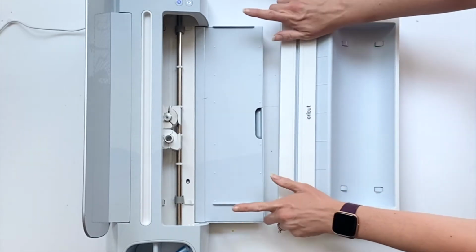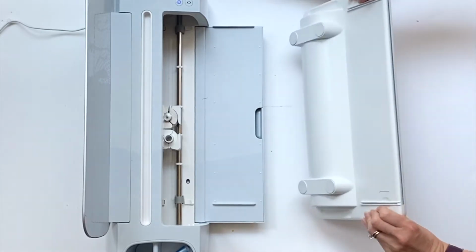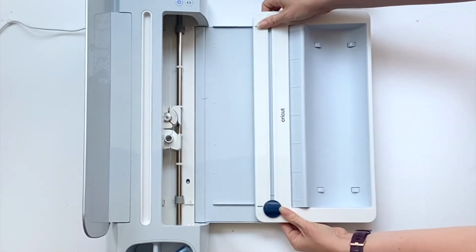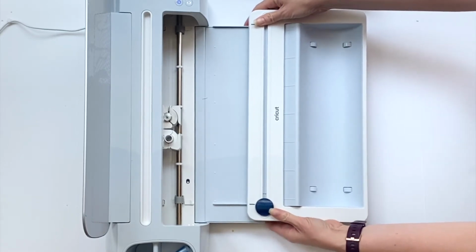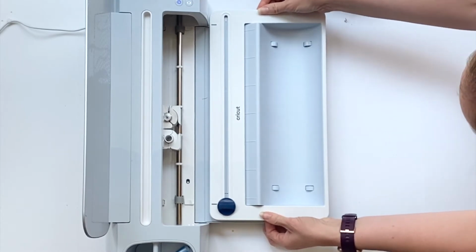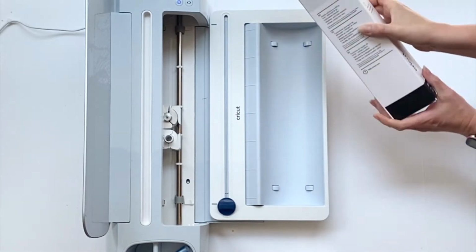The guides line up with the lower tray guides on the machines itself. The channels along the back will slide right over those machine guides. To attach the Cricut Roll Holder, simply align the markings with the machine guides and slide forward. If you try and shift the roll holder side to side and it doesn't budge, you have it on correctly.